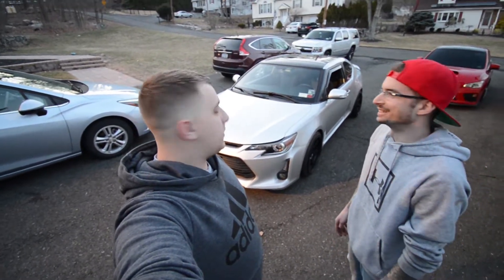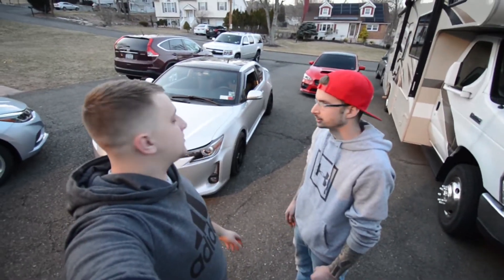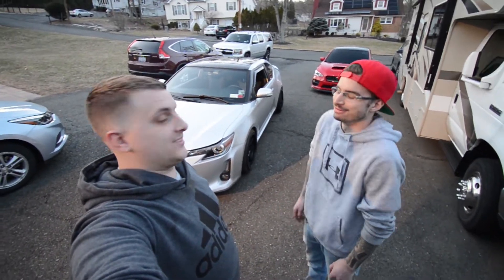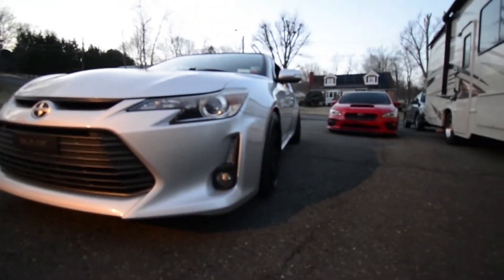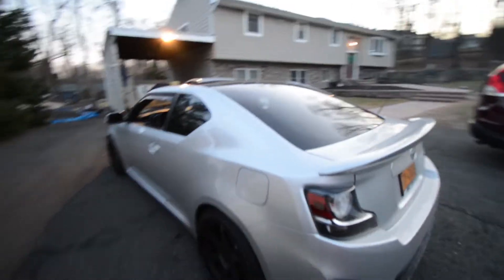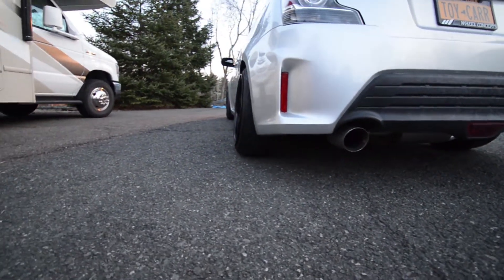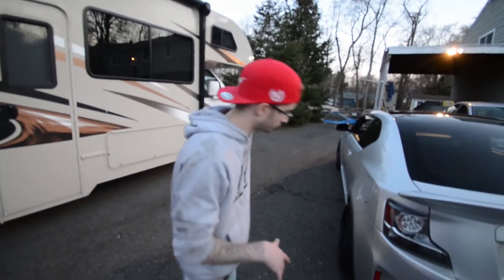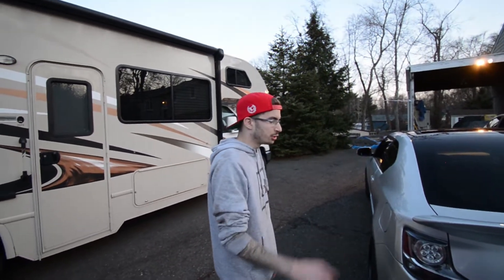Guys, this was a day — what a day. As you guys can tell, it is now dark out. We did run into a couple of snags here and there. Alex had to leave — he had stuff to do for school. But we're beat. My wheels are black and it's dark outside so you guys might have to wait until tomorrow. We are now nice and cambered in the rear. It is a 30mm spacer and we believe it might be negative 5, 6, 4, 3 degrees of camber. The TL's got negative 5, negative 6 in the rear, and this looks about the same. We're going to call it negative 6, give or take a little bit.